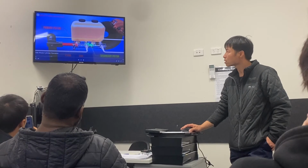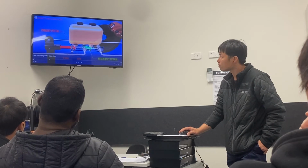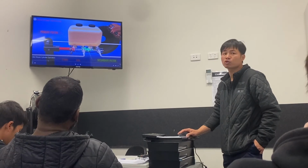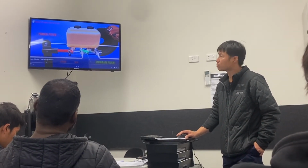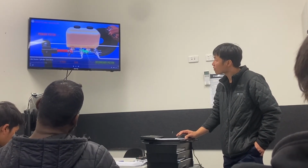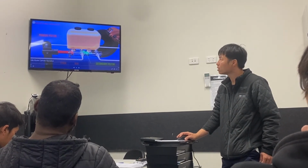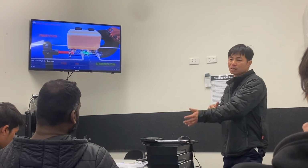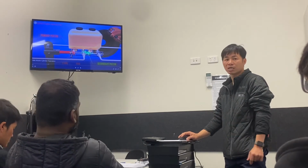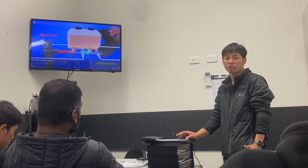This push rod here, normally when you push from the primary cylinder to the secondary cylinder, the secondary isn't actually being driven by this push rod. It's driven by pressure. It's being pushed by the brake fluid here. The blue stuff here is actually for our brake fluid. It is supposed to be the same orange color, but maybe it doesn't want to confuse you, it wants to make it clearer. That is why it's still clear here. But inside this chamber is supposed to be our brake fluid.